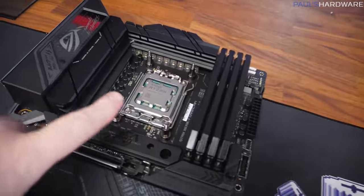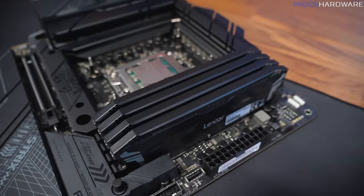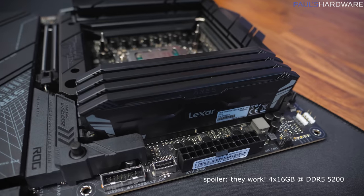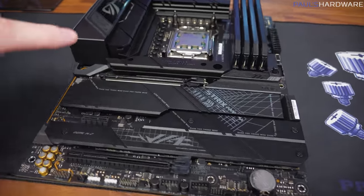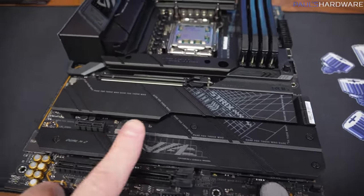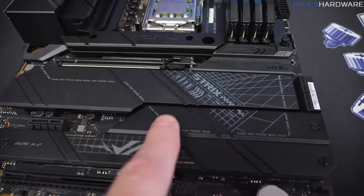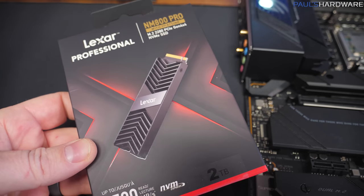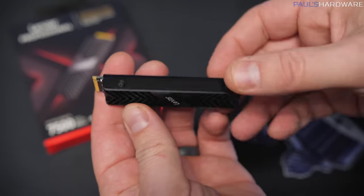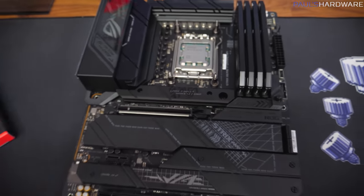Our motherboard setup is complete. We have the standoffs installed for the all-in-one liquid cooler and all four Lexar Ares DDR5 DIMMs installed — it's nice when you can populate all four slots. Hopefully they work out of the gate at their 5200 memory speed. For SSDs: this board has heatsinks covering all M.2 slots. The upper slot is PCIe 5.0, as is the second, and the bottom two are PCIe 4.0 — still full bandwidth to support the Lexar NM800 Pro NVMe SSDs. I removed the heatsink from the one that shipped with a heatsink, and both are installed in the bottom two slots with two PCIe 5.0 slots available for the future.